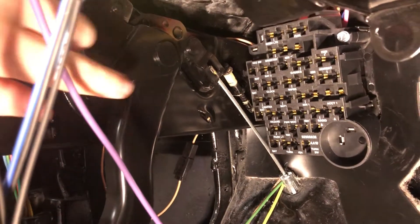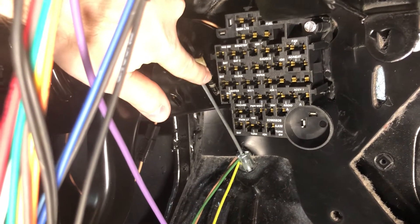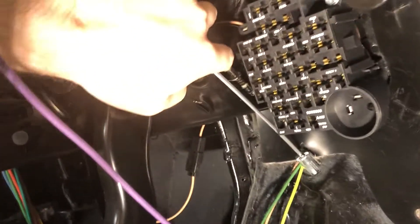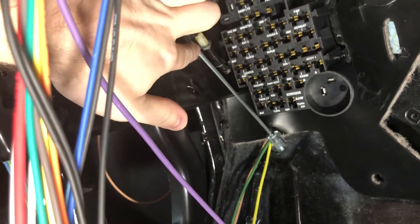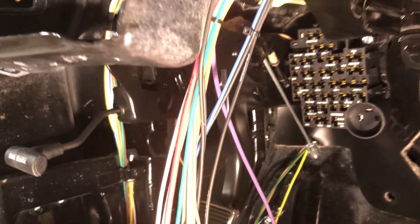If we look back here, you can see the parking brake cable, and the wire is connected — it's kind of hard to see on the other side of the fuse box, but it's connected right there. What you've got right now is the parking brake released, so you can see this back here is pushed away from the metal bracket up here. When you push the brake pedal, it brings those pieces together. Not only does it pull the brake line to activate the parking brake, but it creates a circuit when these two metal pieces connect, and that will light up the emergency brake light — also lovingly referred to as the idiot light, because if you're driving a stick shift and you don't check the parking brake, well, you're kind of an idiot.